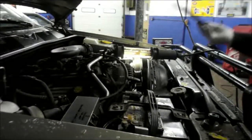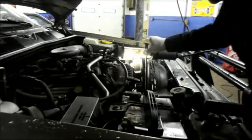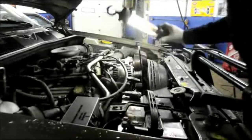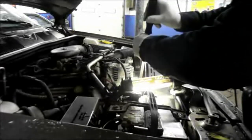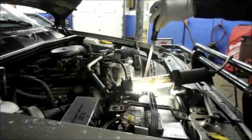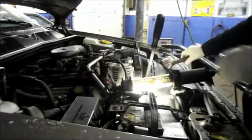I just take the tool that fits onto the water pump — it fits right onto the nut on top of the water pump. The pump is loose itself, but what I normally do to make it a little bit easier is take any kind of pry bar or large screwdriver and put it in between the fan, down between the fan and the pulley, and just wedge it in there behind it. Then put your wrench on and I'll show you how easy it comes off.